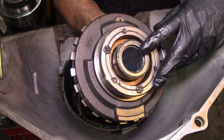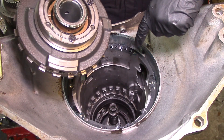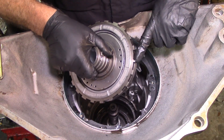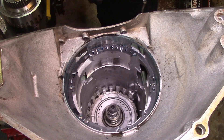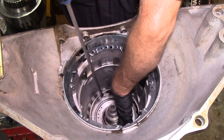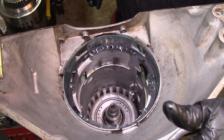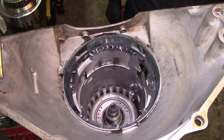It has a new bushing so it goes a little firm. Now drop the center support - it's a three-piece bearing, here's the other race. Once we do the rear we'll do the center. Install the center support with the bolt going towards the front, and you have the alignment guide that's going to guide you to where it goes. Drop the snap ring with the opening at the 9 o'clock position from where I'm standing - that's 3 o'clock from the top of the motor side.